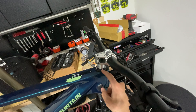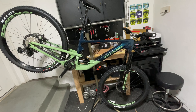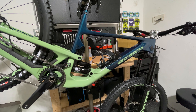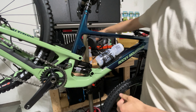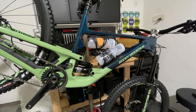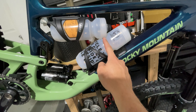It's a couple hours later and we are getting close. I was honestly slightly concerned about the color since I've never had a colorful bike before, but man, in person it looks better than the pictures online. This is basically all stock — I'm going to put my favorite seat on there and put my pedals on. Since none of the tracks this weekend are crazy steep, I switched the Ride 4 chip to the steep position. That puts the seat tube angle at about 77.8 degrees and the head tube angle at about 63.8 — the steepest position possible on this bike. I also dropped in the minus-five headset to bring the reach in just a little bit. We'll see how that feels.